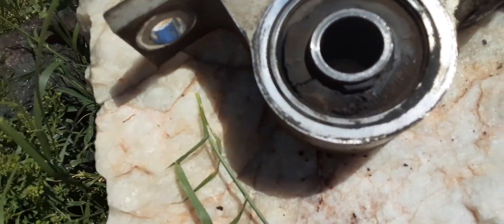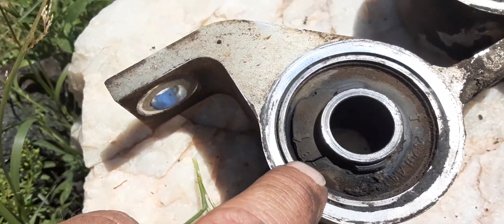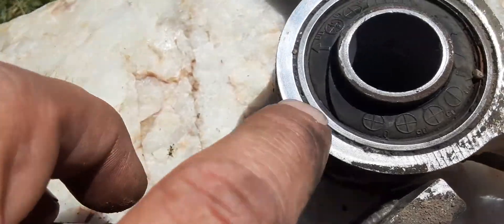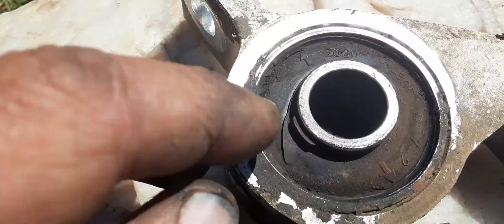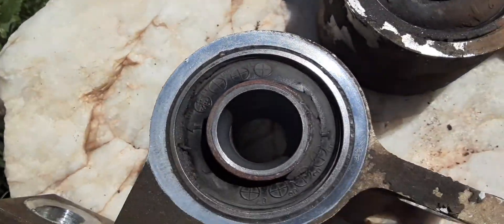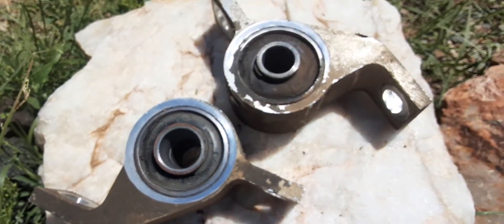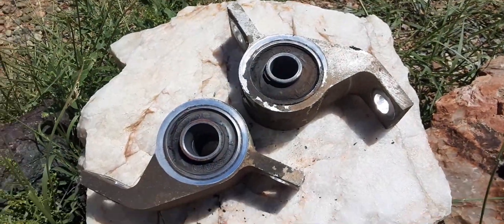It is the cause if it's broken. You can see it's shredded all out right there, and this one is shredded 100% all the way around. It's completely disattached. So that may solve your wobbly steering wheel at highway speeds.